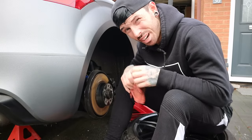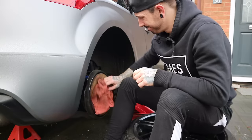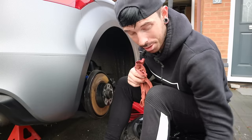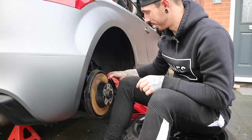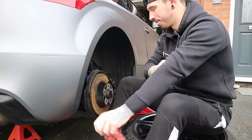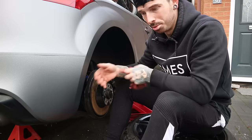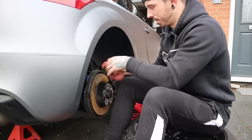Would you like me to tell you what's good about UK wintertime? Absolutely nothing. Looks like we're starting this video off with you guys sitting down with me, changing the rear caliper on the Audi TT because the handbrake is sticking on and it seems to be a problem with the caliper. You pull the handbrake and it doesn't return back to where it should do, so it causes the brake to stick on.